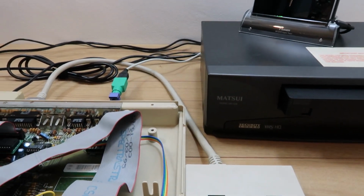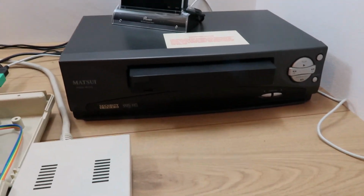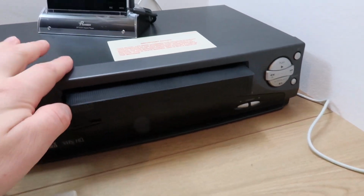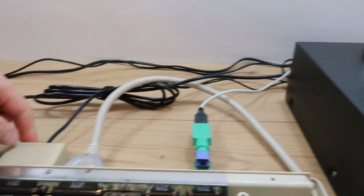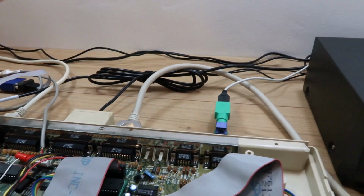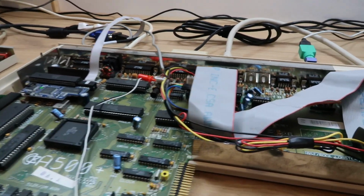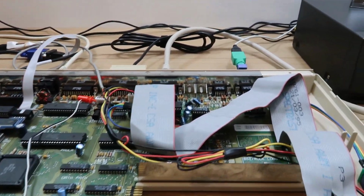It sort of creates a pattern on the screen which the video recorder records, and then when you want to restore your data, you play it back, and the input is achieved by going into this little box, and this basically decodes the composite signal somehow and reconstructs the data back in the memory, and then obviously that data is then copied back to your floppy disk or your hard disk, depending on the kind of backup you've done.